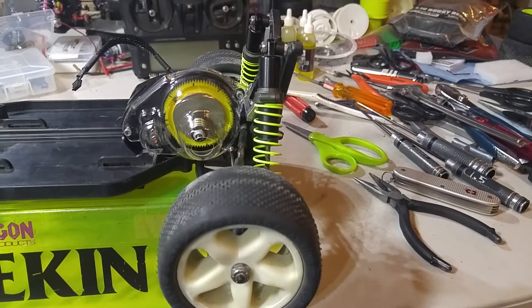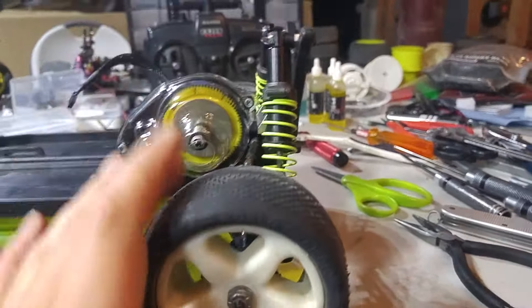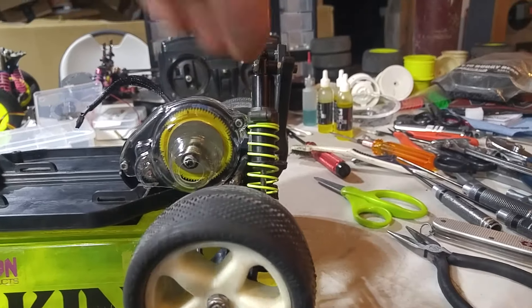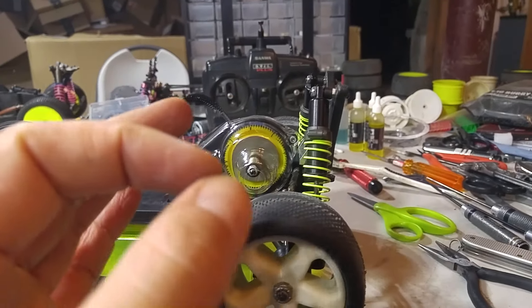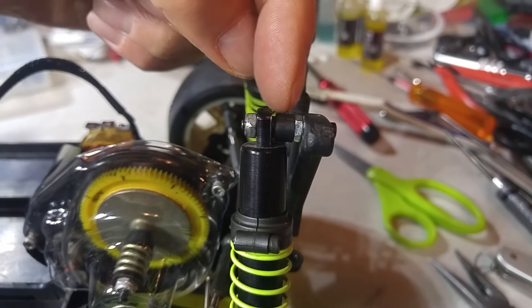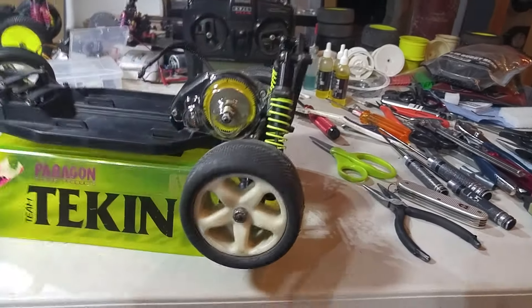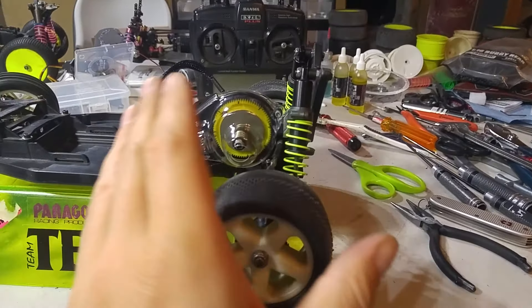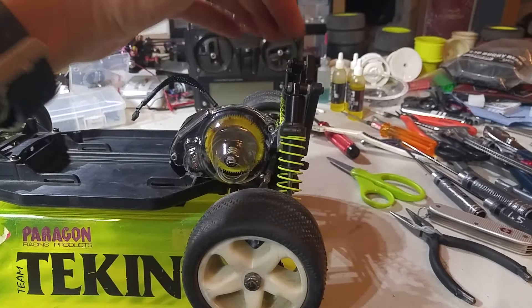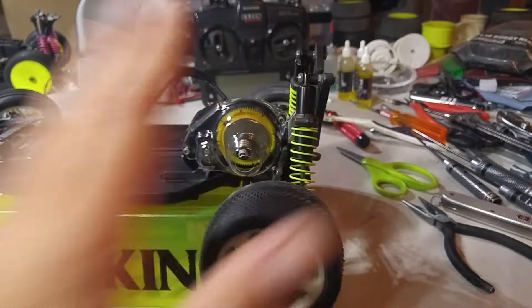I'd also like to straighten out the rear shocks. The shocks are mounted at a slightly forward angle from front to rear. Generally in this profile you want the shocks to be perfectly vertical, because any extra angle slightly varies the geometry. You could change the types of spacers used here, thin down a spacer to move things back just a bit, or put spacers between the shock tower and bulkhead to move the tower back and straighten out those shocks. I haven't done that yet — I'm not sure exactly what the best way is, given that these shock bushings for the low-C shocks have a specific size and I don't want to cut them. Maybe this very slight angle is fine enough.